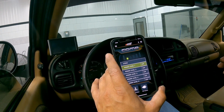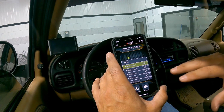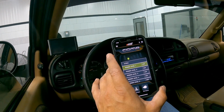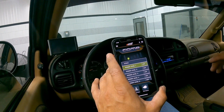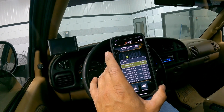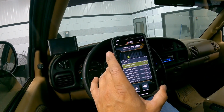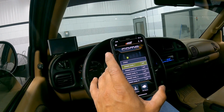So you're going to get the absolute best RPM and performance out of your VP44 with this comp. We have tested and compared it with some of the other products on the market. One of the other custom tunable VP44 devices, in this specific truck, we really started having high RPM fuel pop. The dyno really showed a lack of performance in that higher RPM. It wasn't fueling like it was supposed to. There was some breakup. This device, with the comp installed in this truck, we were able to get 3, 4, almost 500 RPM more fueling out of the competitor's product.